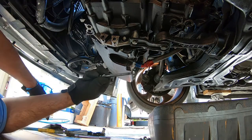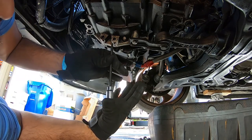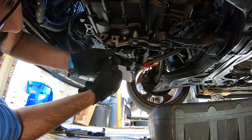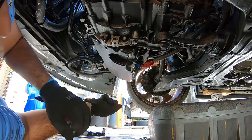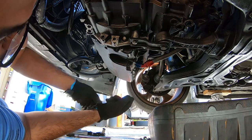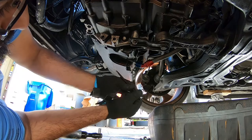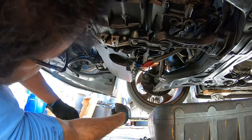Yeah, so a 5 millimeter Allen wrench is what you're going to need. These nice long 6 to 8 inch ones are the best for this job, so you can get up in there in a really tight area. Try to get one with a socket, not just by hand. You're going to be there way too long, and you have a really high risk of damaging the threads. So be forewarned. Cool, that's also a 5 there as well.